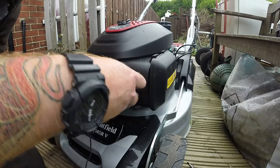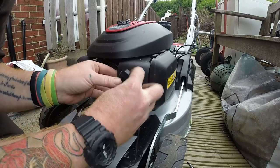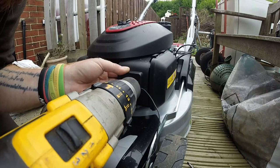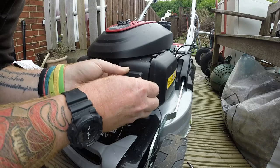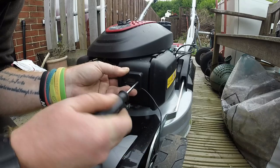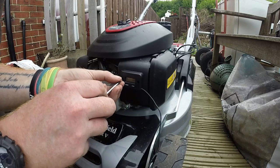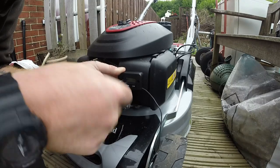You place the cable in the back of the module and you've got to force it in really tight, because it reads through magnetic interference — I can't remember the exact term right now. I drill a little pilot hole; I've already checked behind the air cover and it's just a bit of plastic, but make sure you check behind because you don't want to drill straight into a fuel line or anything like that. Put your screws in — I always pre-drill the first one to hold it in place and keep the wire tight. The second one I just let its own thread force through. I've fitted a few of these already, so I've pretty much got it down to a T.